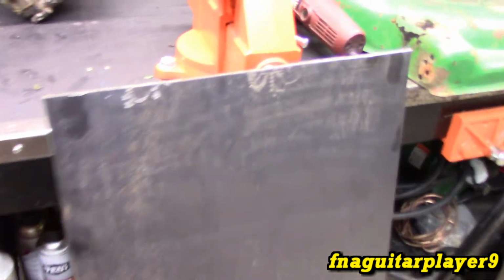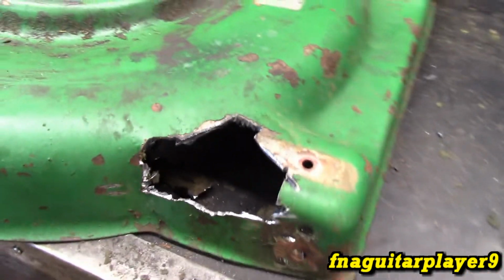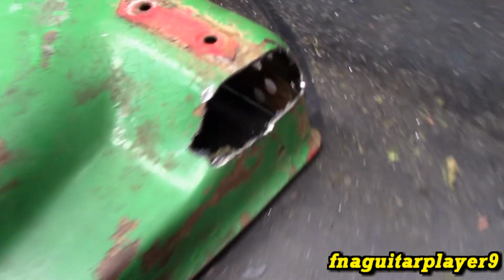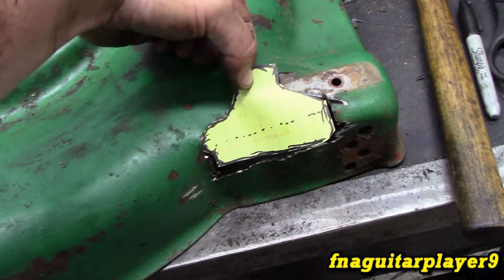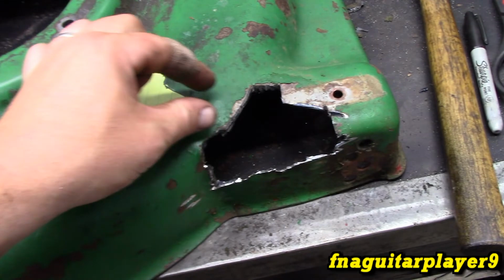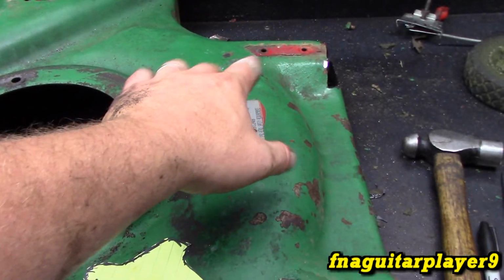And the metal I'll be working with is this 1/8 inch steel that's left over from the top of the workbench. So anytime you're doing something like this, same way as body work on a vehicle, you really want to cut out the bad metal with the rest of that. So I made a paper template here, kind of the shape of the piece. And kind of do it like this, and probably put another piece over it and bring it over just to strengthen it even more.